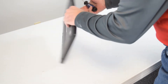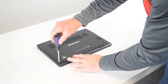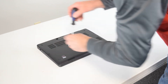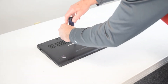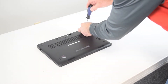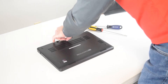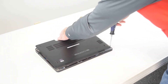We're going to start with this Dell Latitude E7470 laptop. We're going to flip it over — we have to take the bottom off. There are several Phillips head screws; we use a number one Phillips screwdriver. A lot of the new designs have gone to internal batteries, very slim lithium-ion, but in order to keep the laptop slim, if you change the battery you have to take the bottom off. Using your Phillips screwdriver, undo the screws around the perimeter, and then a flat-head screwdriver is the easiest way to pry — once you start it, it'll just pop off.